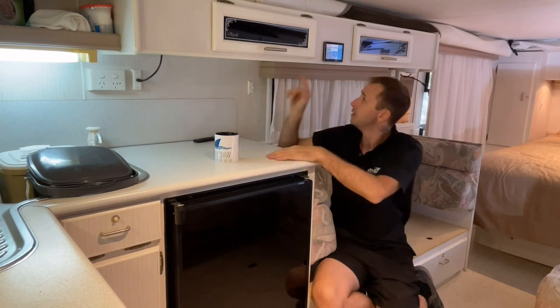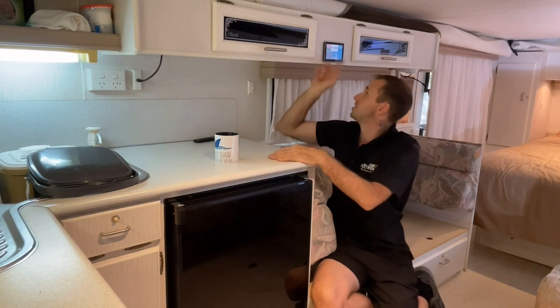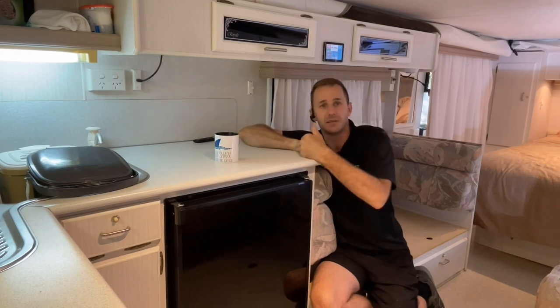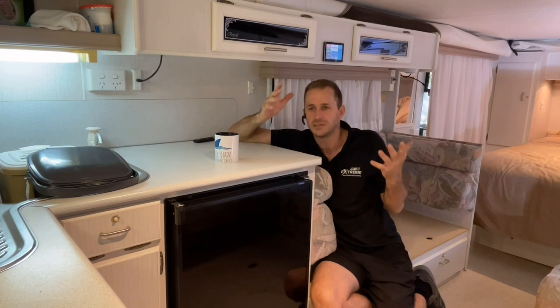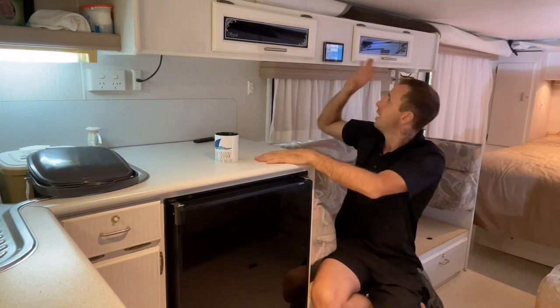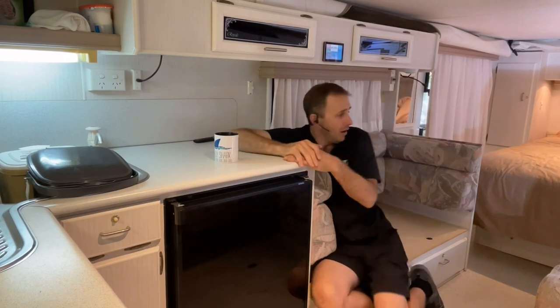You set on this what you want the most to be pulled out of that line. So I'd set it for 9.5 or 10 amps. That way it'll hit 10, and that's it. That's the limit. When you want more, it's going to come from the batteries. It's a really, really awesome system. I really, really love Victron how they do that. And it's all done on the touchscreen up here, guys. So, yeah, I can't fault this system.